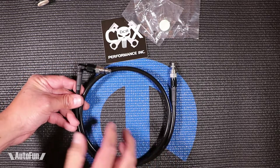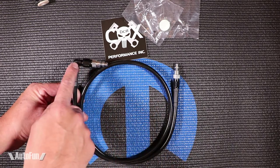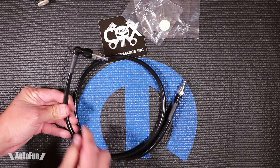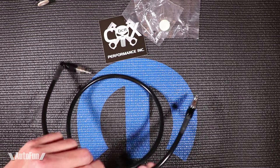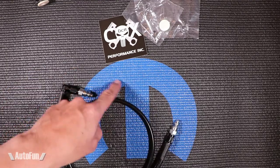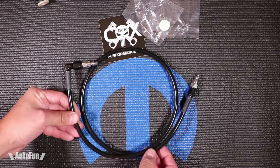One of the cool things about it is that yes, you can go and purchase all the individual parts and components yourself and find part numbers online, but why go through all of that when you can just buy this kit from DCR? It's already fully built, it has a really nice black finish, and the braiding line is covered in black plastic covering. The reason why that is important is because braided lines are abrasive — as they are riding in your car and moving, they are rubbing. Whatever they're rubbing against could potentially be damaged: if you're looking at wires behind it you could have shorts and electrical failures, if it's rubbing against the body it's going to wear your paint, if it's rubbing against another fluid line it's going to cut into that line. So if you're going to go to a braided line, go for something like this that is covered in a black protective covering.